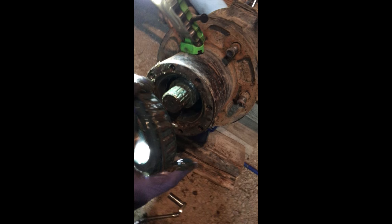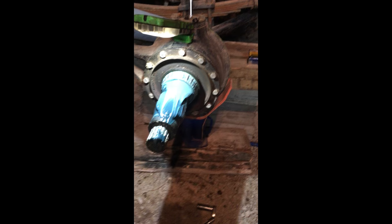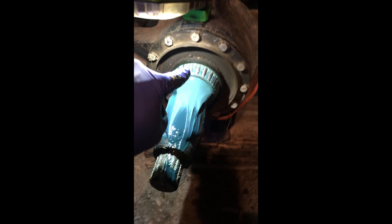Pull this back and grab the bearing on the outside. The seal only goes one way — on the inside — and the bearing only goes one way, tapered side in. Now we'll pull the whole hub off. You can see the inside bearing; you can leave that.